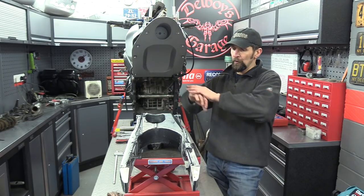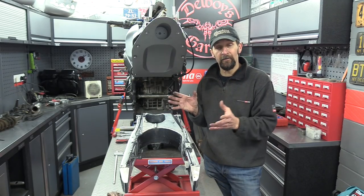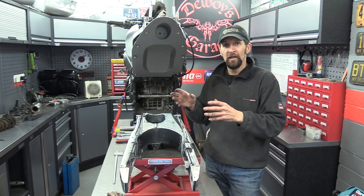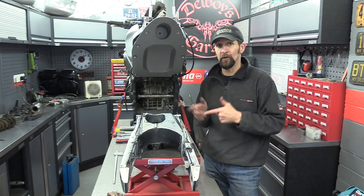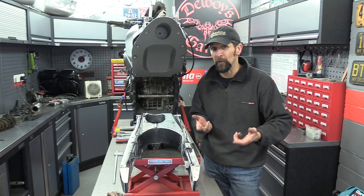Then once you know you've got an all over coat of paint that isn't going to react, it's absolutely grease free underneath, you've guaranteed it by testing it, then you can go and chuck three or four cans of paint at it to make a nice finish. You don't want to be putting all your top coat on and finding out you've got to do it again. So there we are, test paint first and then final paint after, so it'll be quite a process and it'll